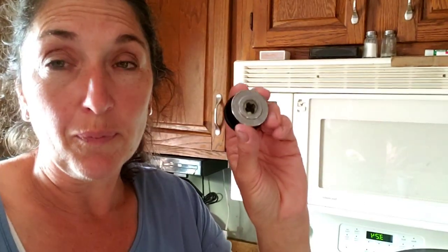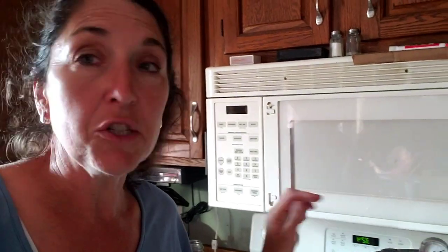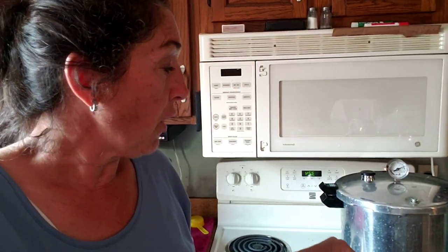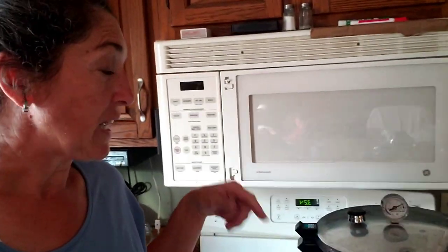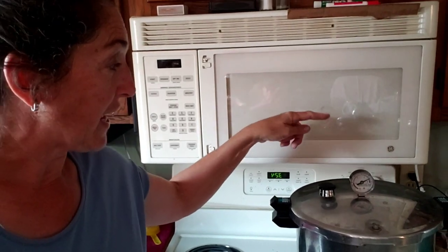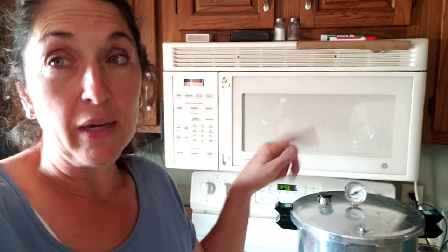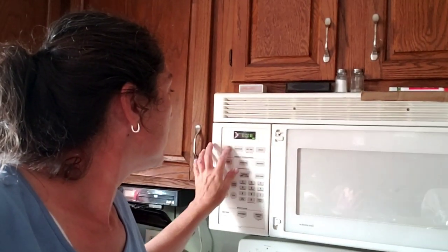We'll put this weight on and reset the timer. If you ever have trouble with your lid or excessive sweating, get yourself a rebuild kit or a lid kit — different models have a different kit, so you need to know your model number from the bottom of your pot. For me, the kit came with the lid gasket, a gasket for inside the weight, and your overpressure plug. If that overpressure plug ever blows, you have to replace it — you can't reuse it.